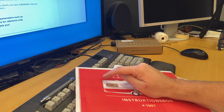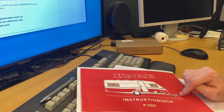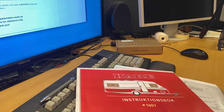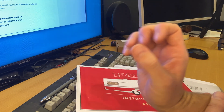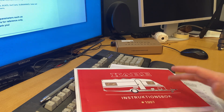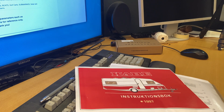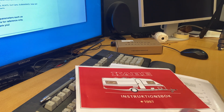This marker light wasn't working - it was oxidized as hell in there. I took care of that; it's now shining. I had the whole connector apart, and there was a lot of oxidization and old muck in it. So I cleaned it up, and now all the lights are shining brightly. You can have the brake lights on and the blinker on without the brake lights pulsating in step with the blinker, as it used to. It still has a few electrical gremlins though - every now and then the marker lights will flicker.